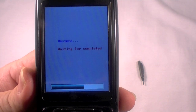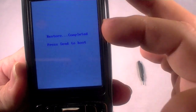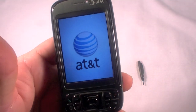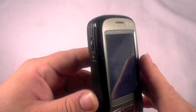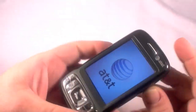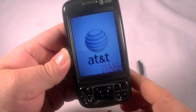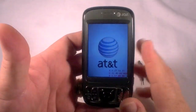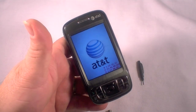We're hitting Send to restore, waiting for it to complete — which makes a lot of sense. This device served me quite well. Press Send, restore completed, press Send to boot. Now we're going to have to wait a good amount of time for the ROM to propagate all the software back into place. Once it's finished booting, all my personal data will no longer be on here, and I can hand this to a friend or family member, or in my case just store it in my graveyard. Thanks for watching — that was a hard reset on the AT&T Tilt.